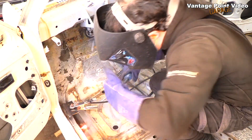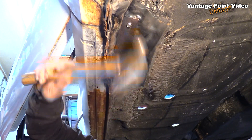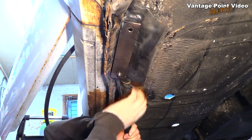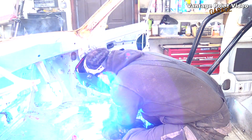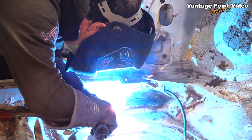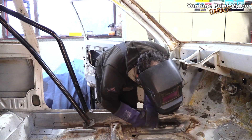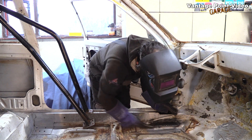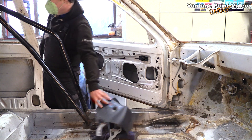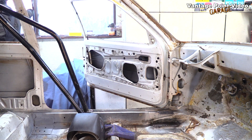Welding the ends of the floor plate now, and I'm going to take off the underneath reinforcing so it doesn't get welded on by any penetration through the floor. It wouldn't really matter if they were actually fixed to the floor, but I haven't treated them yet, and since these are outside I could theoretically replace them in the future if they became weathered. Those are my long welds in - they got a little bit messy because you're interfacing between three millimeter plate and very thin floor, but not too bad. I've got a lot of burnt sealant so I'm going to get out of the garage pretty quickly. I'll weld in three plates to join the top and the bottom in my next video.